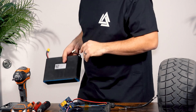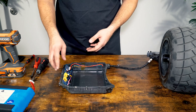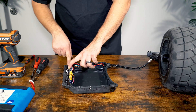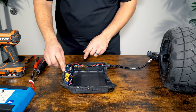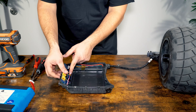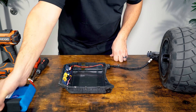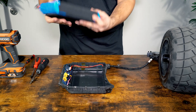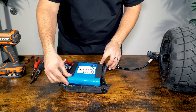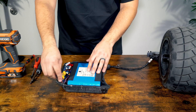We'll go ahead and put that to the side. Now is a good time to check your headlight connector and charge port — make sure that everything is still in place and not loose, as these connectors can unplug themselves over time from shipping or aggressive use. The CBGT will just drop right in — it's a very easy fit, possibly even easier than the stock battery in terms of fitment. We're going to go ahead and plug in our XT60 connector first.